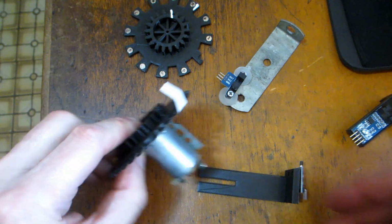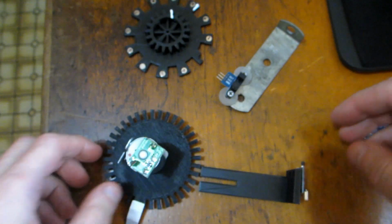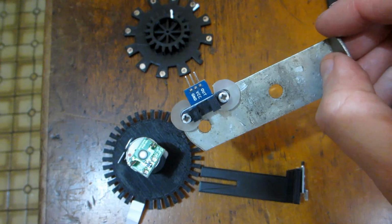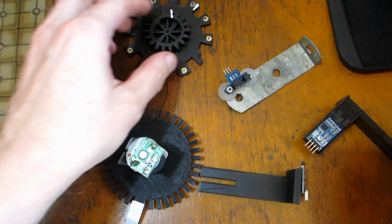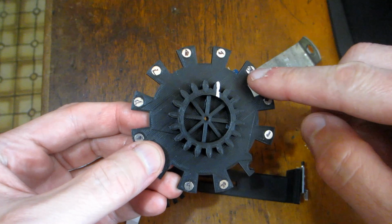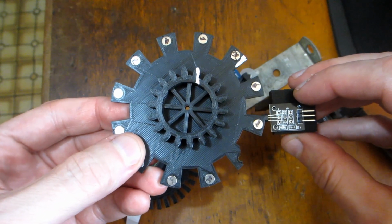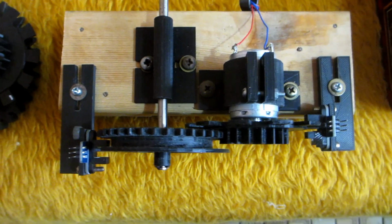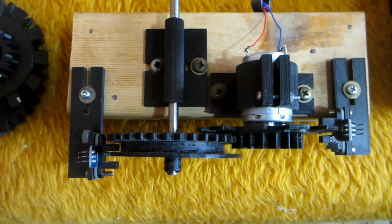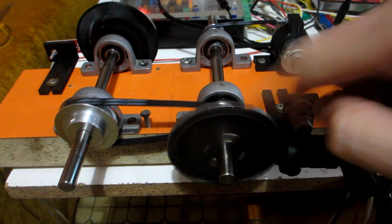You can even run it mechanically with a wheel on a motor. Some optical sensors, and even magnets embedded in a wheel with a hall sensor. You can even build a mechanical rig with the crank and the half-speed cam and cheap Arduino sensors. You can even build rigs that will test the actual wheels and the sensors you'll be using.